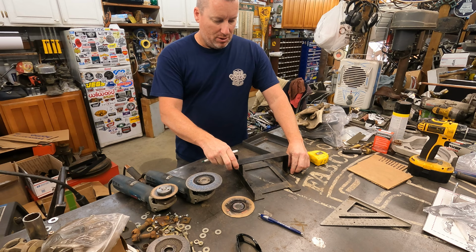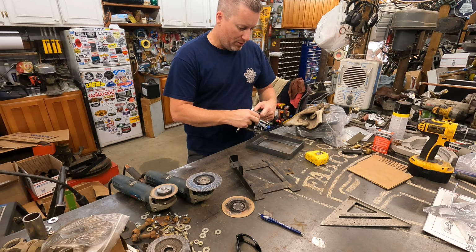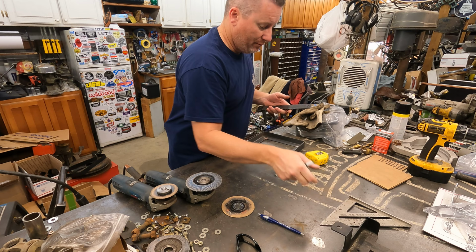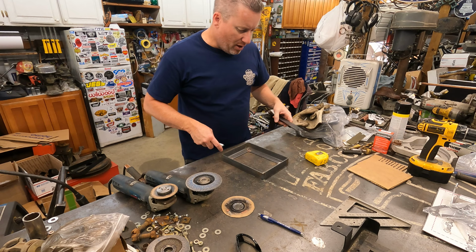But I'm gonna utilize this. This is gonna become my leg over here, go to the floor. And then I'm gonna cut this part up to be my new tabs here. Already got a hole drilled, so might as well. I'm not gonna put a 6 volt Optima back in there because they're too dang expensive and didn't last very long. So I'm gonna utilize this metal that I've got. This is just 1/8 inch, looks like 1.5 inches maybe, flat stock.